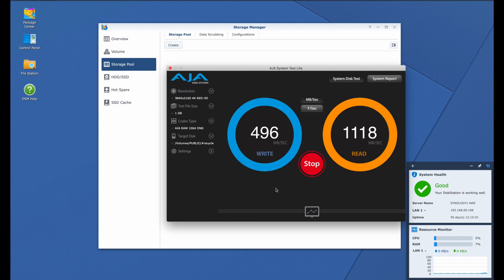With a 1 gigabyte transfer size we're seeing a very significant improvement in read performance at generally well over 1000 megabytes per second. Running the same AJA test over the 10 gig connection to the NAS in RAID 10, we're seeing a modest increase in write speed — closer to 500 megabytes per second versus the previous 450 on average. Read performance is maybe slightly better but not significantly improved. Switching to a 1 gigabyte file size shows closer to 1000 MB/s, about 8.5 gigabits per second throughput, which seems pretty decent — though I didn't run this 1GB test with SHR2 for comparison, unfortunately.